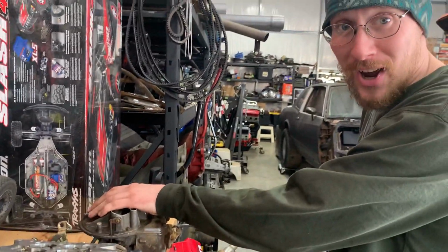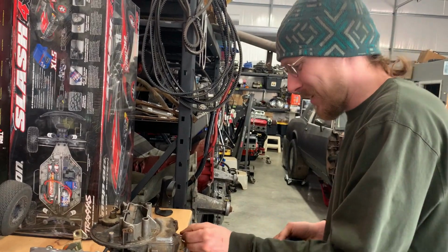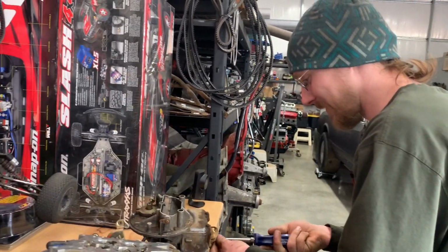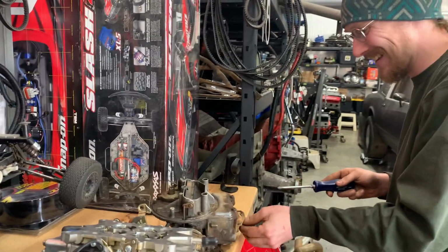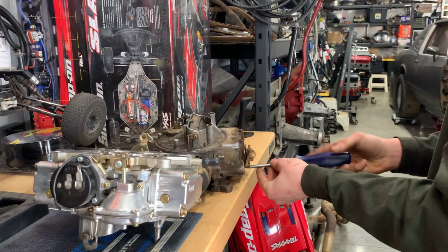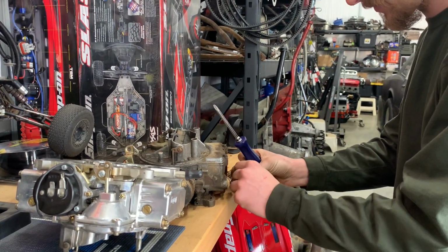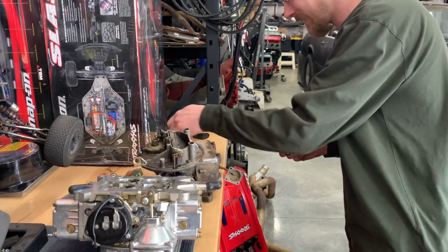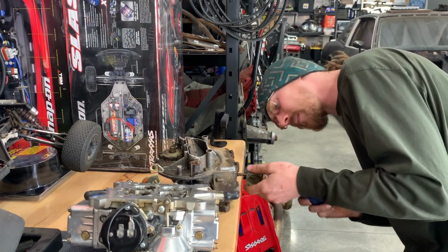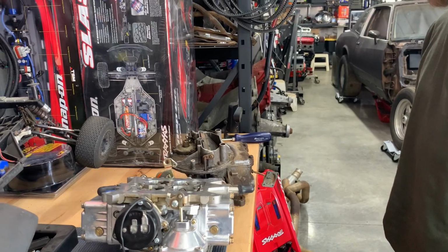Anyways, so we went and we just got a diaphragm because rigging was going to go poorly. Yeah, very complicated. Not planned out very good. No, I'd rather spend $5 than break stuff. So here we are doing it the right way, sort of. It should work better anyway. It's not that dirty on the inside for what it is and how long it has sat. We attempted to take the one out of the Holley 600, but it's a rectangular diaphragm instead of a square diaphragm, so it would not bolt up. No, it was not going to work, unfortunately.